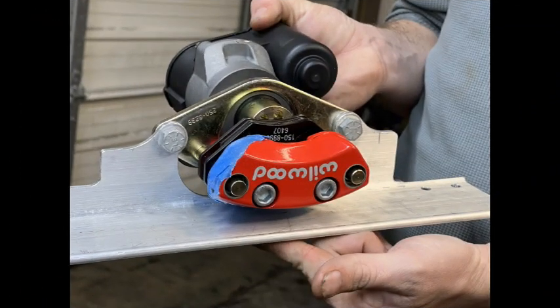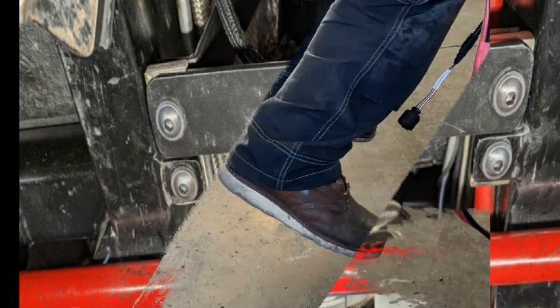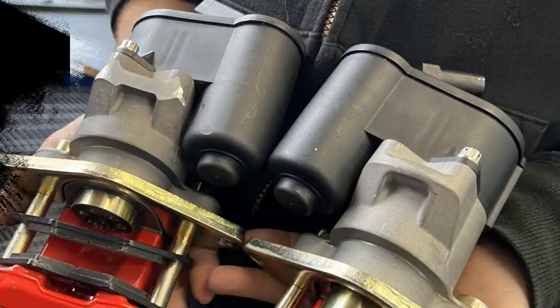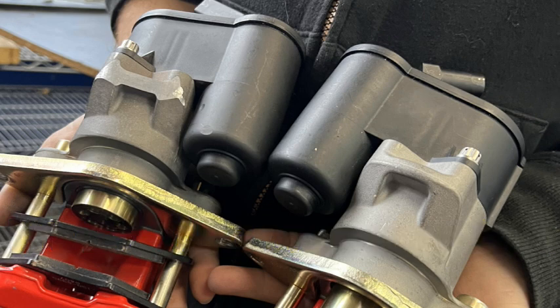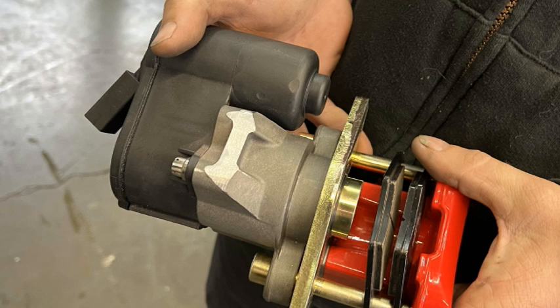Here are some random shots of our progress as this project proceeded. We needed to make the brake bracket work around some of the electrical and fuel lines — it would have been too difficult to reroute those. This picture shows the brake caliper after it was actuated. To say that it clamps down tight is an understatement. Even with moving the brake rotor face back toward the differential, we still had to make some room for the drive shaft hub, because when everything was bolted up it still just lightly touched the drive hub. But just a little work on the belt sander took care of that problem.